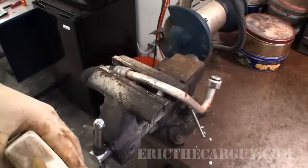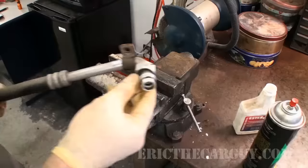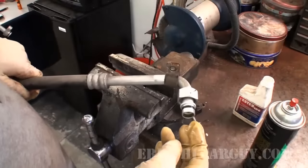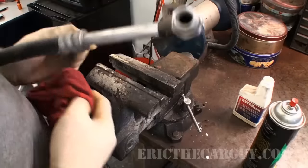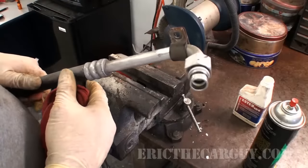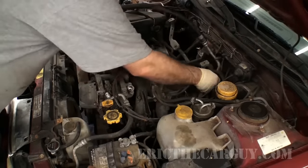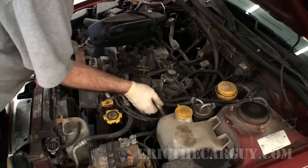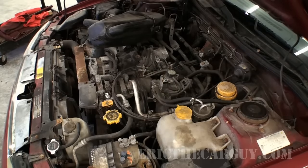Here's some oil that's good for R-134a systems — oil for R-12 is different than oil for R-134a. I'm going to lubricate that quickly. It's a good idea to replace these O-rings. I lubricated the O-ring a bit and I'm going to go over and install it on the vehicle. The installation is pretty much the reverse of removal. Once you get it on there, just another quarter turn or so and you're done — don't run it down so tight you strip it out.